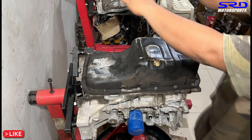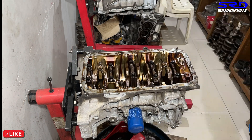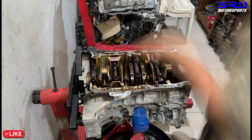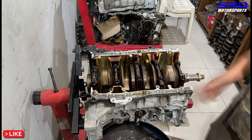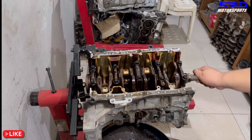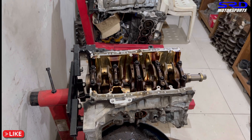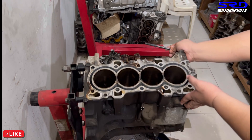Now let my colleague disassemble the engine — getting the oil pump off and the oil pan. We already drained the oil earlier. It's a bit brown but looks decent — nothing abnormal, nothing looks like it was changed. It looks decent for a high-mileage engine. Now turned by hand, the crank turns really well, so we know the crank is not bent and nothing is wrong with it.